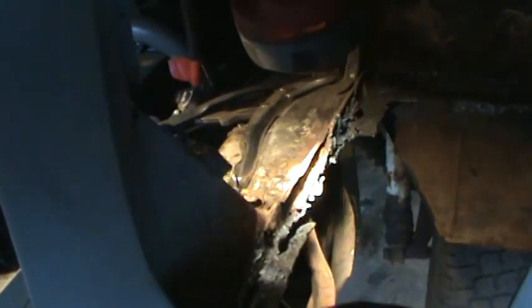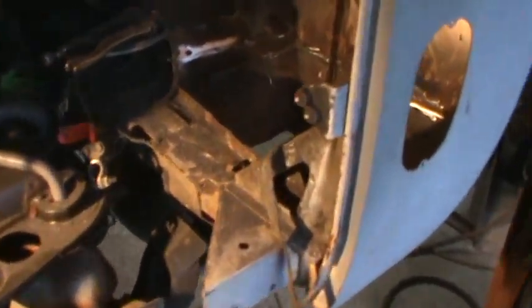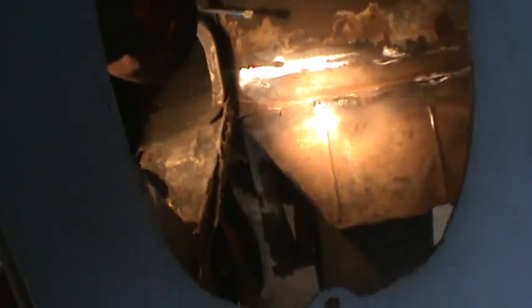It's a little hard to get cutting wheels in there on the corners, so I'm going to get the small one in there and start buzzing across that top strip, working on that top layer first. Then maybe we can get a flapper disc in there for the lower section. Judging by the dirt on the floor, that was thoroughly a pain in the ass. But got it pretty much cleaned up. You can see where the top pan was welded on — where it's shiny right there, that's all been removed and ground down where the welds are.